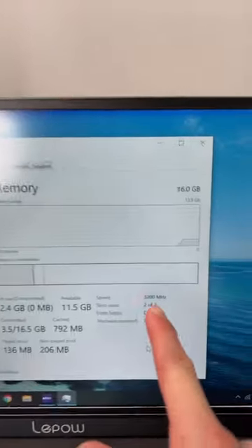Opened up Task Manager — that is looking a lot better. Technically, running the XMP or DOCP profile on your RAM is considered overclocking, and you might have a more unstable system, but you get faster memory, so why not just do it? I wish NZXT would just enable it on all their pre-built systems, but I'm pretty sure they have a reason.